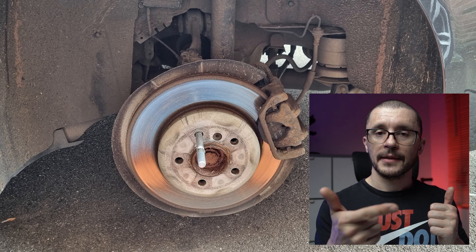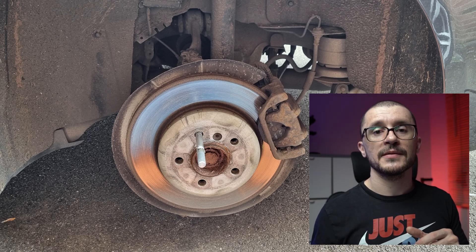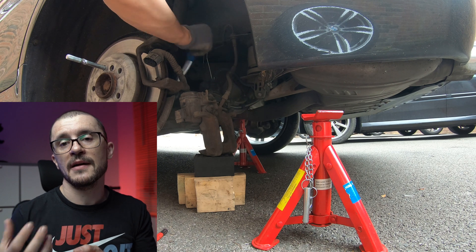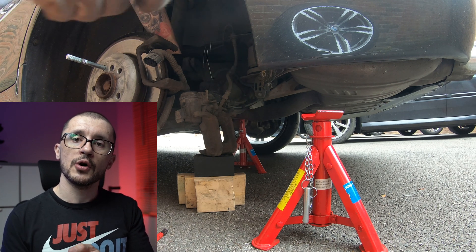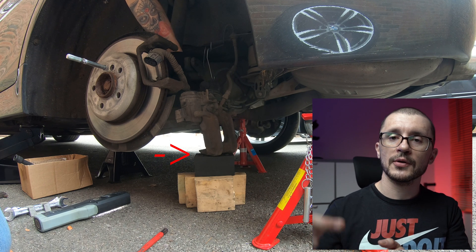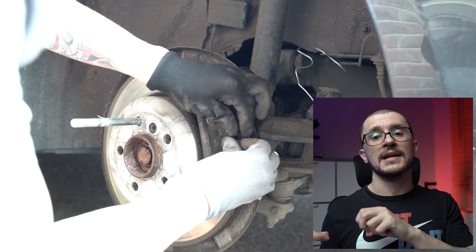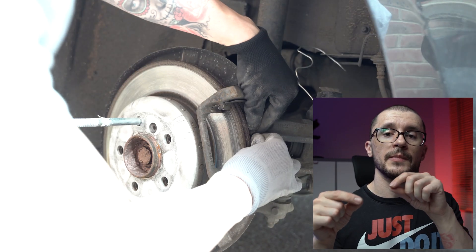Vehicle is lifted, the two caliper bolts have been undone, and all the connectors have been disconnected. At this point we should be able to twist our caliper — always start from the bottom, twist it and slide it out. Providing everything else is disconnected, we can push it to one side. I've always prepared something to hold it on its lower side so it's held in place and the hydraulic cable is not tensioned. Now we have access to our brake pads and can inspect them. Usually the front brake pad will slide out easily while the interior one is the one that is seized.